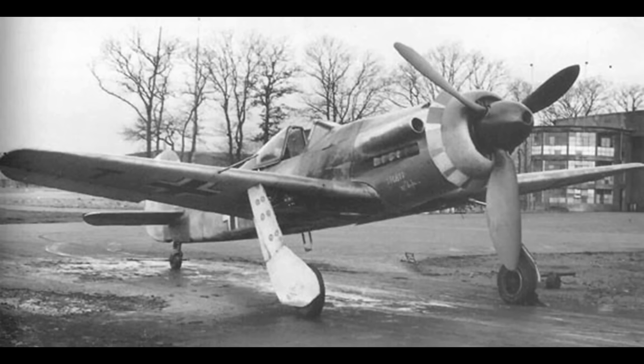The TA-152 has at least two stages of GM1. I believe each stage adds 120 horsepower, so really not all that much. We can see those clearly on the performance charts, the stages, that is. However, it may have had three stages. Typically, they'd provide, like I say, 120 horsepower per stage, but you know, they could change nozzle sizes and make them add more, up to whatever the engine could structurally handle. It's very difficult to say exactly what they had in operations, but two stages at 120 horsepower each is supported by what little documentation we have.